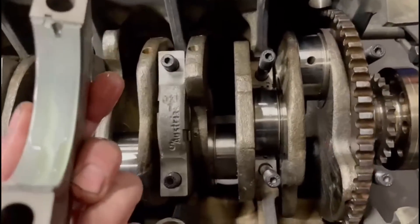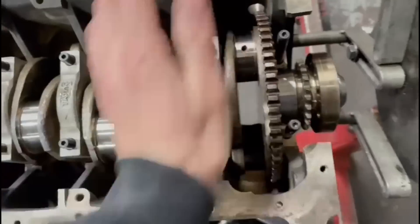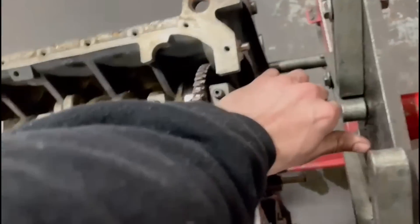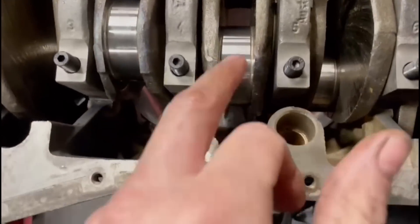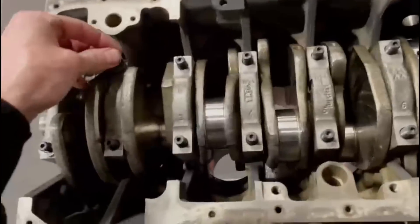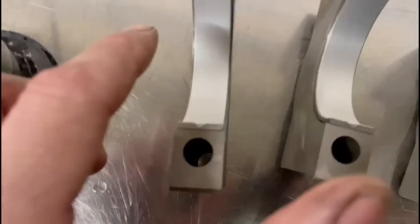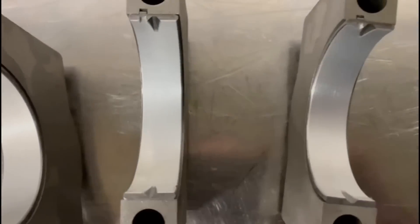So cap loosed up, make sure the tag on the bearing sits on the same side. Make sure that's seated properly. Get these washers on the main studs - fresh washer on cap number six, which we've already put on off camera. It's also worth mentioning, make sure the bearing is sitting in the center of the cap. Obviously you've got a locating tab there, but sometimes the bearing can sort of sit squiffy, so it's worth just double checking.